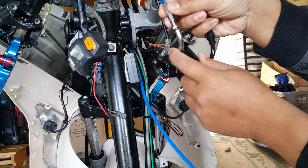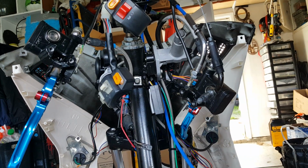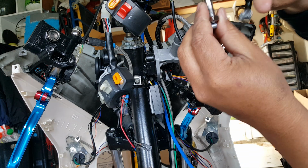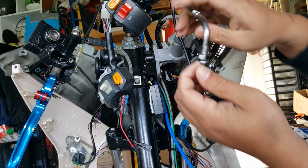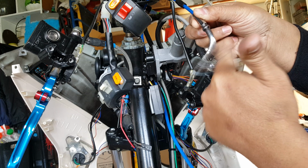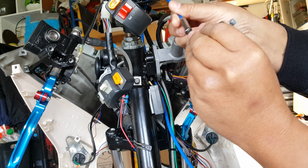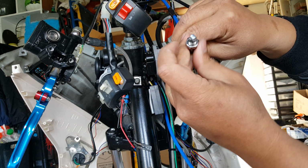So you can see here, you also have adjustment here as well. Again, the ends are going to be the same. We have to change it because the other end is for a smaller needle for the PWK one. So you can take this all the way in more if you want to. That'll free up some slack. And then you can get ready for this guy here.